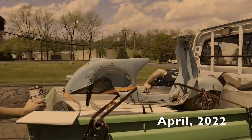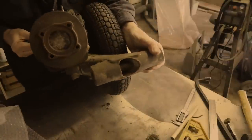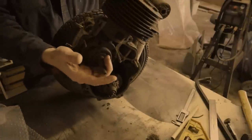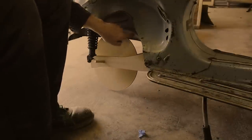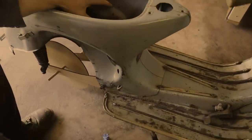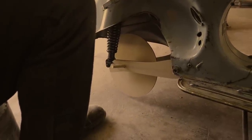We discussed the project before the filming day. Matt showed me the basic assembly: the motor hangs on a rear swing arm that bolts into the body, with the rear suspension attached there — the whole engine and transmission powering the rear wheel. Since we want an electric hub motor to sit in that position, we needed to build a swing arm that bolts into that spot and holds the hub motor, with plenty of space up front for the battery. I made mock-ups out of cardboard and put it in Matt's capable hands — and he one-upped the whole thing.